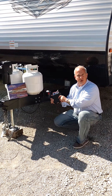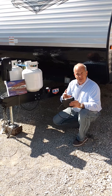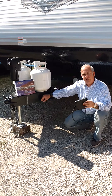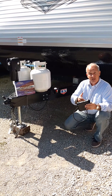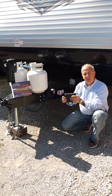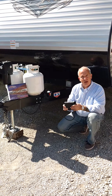It just needs to understand where its new home is. Once Autobrake is on your trailer, you're ready to plug in and just tow down the road. There are three settings — it'll work on one, two, and three axle trailers. Another great feature is that many tow vehicles already have brake controllers installed. So if you plug in a trailer and you already have a brake controller in your tow vehicle, Autobrake will pick up on that signal and shut itself off. You don't need to disable or disconnect anything — it'll do everything on its own.